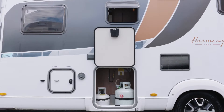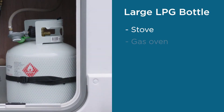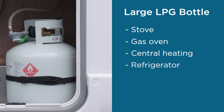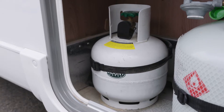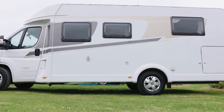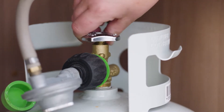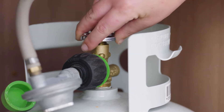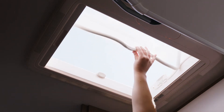The LPG bottles are stored in the LPG locker. The larger LPG bottle operates the stove and gas oven as well as central heating, refrigerator and water heater when these are in gas mode. The smaller bottle is the reserve bottle. Be sure to park the motorhome on flat ground when using LPG. To turn on the LPG, slowly turn the tap anti-clockwise. If you turn it too fast, the LPG may not flow. Make sure the living area is well ventilated before turning on the gas stove.